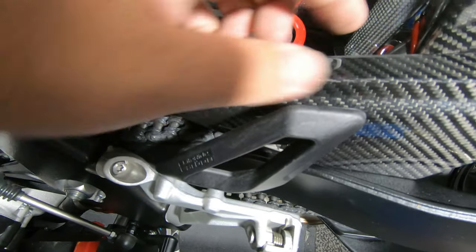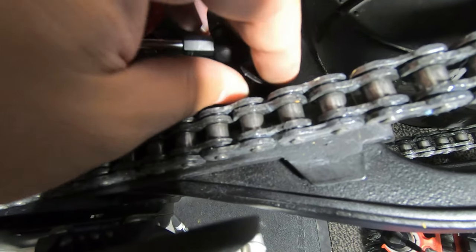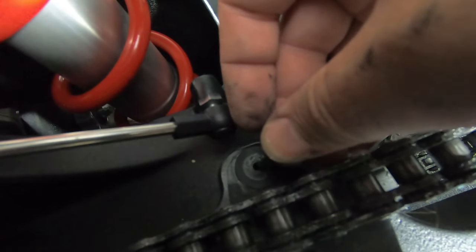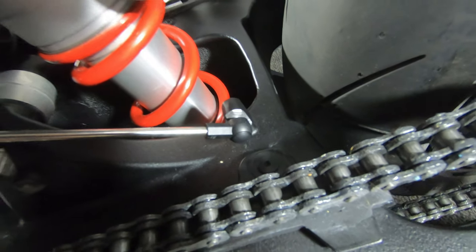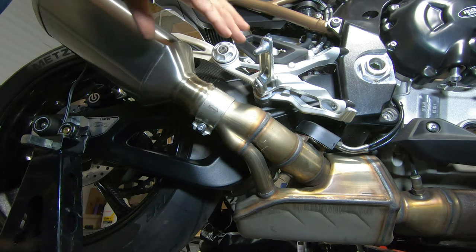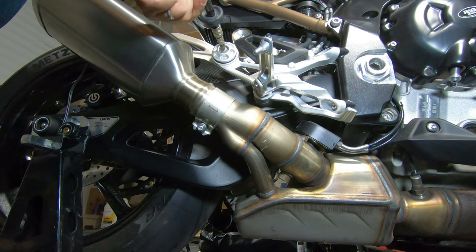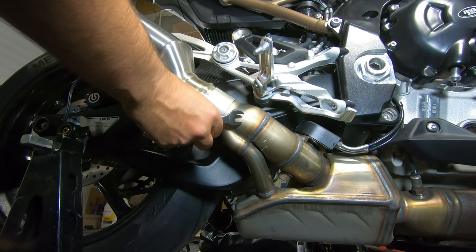Once we've taken that off, we're going to offer up the new one. The little bolt in here needs to go back in before you put this on, because this hasn't got the same hole just down here for that little bolt to go in. So we're going to replace this little bolt first and then put this on again. First of all we're going to replace the little plug that came out — that goes back in there — and then we're going to replace the little bolt straight back in the hole, and it literally just pushes down. So now we're going to put the carbon fibre tail piece on. Put the exhaust back in place, just going to tighten up the bolts, tighten up the Jubilee clamp.